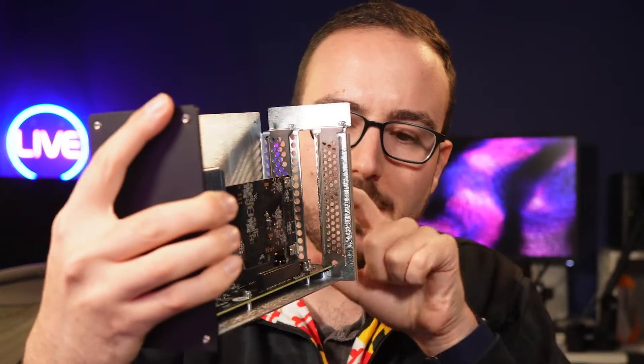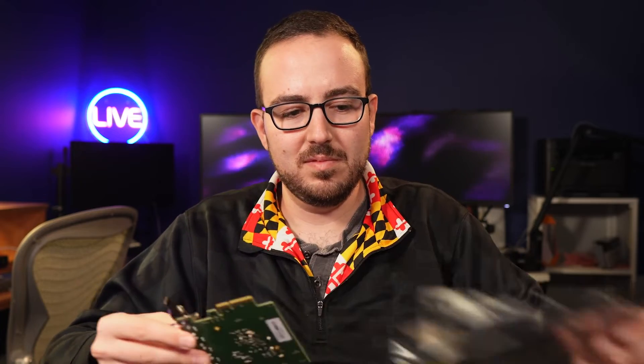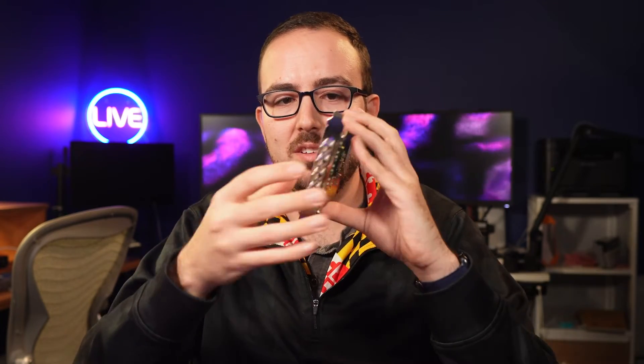So we've got that loosened up and out. You can see the Decklink is going to slot right into this empty space, and there's also a slot right on the board for it to plug into. Time to open up the Decklink Duo 2 — this is inside one of these electrostatic protective bags. I'd recommend making sure that you're grounded; you can get an electrostatic bracelet or just touch something metal that's grounded to get any static electricity out of you before you get started. Probably wasn't the best move to wear a fleece shirt, but we're going to risk it — touch metal, just in case.